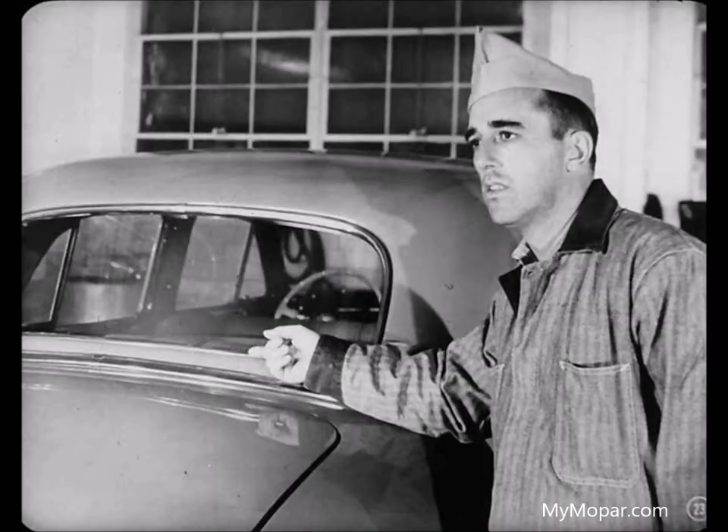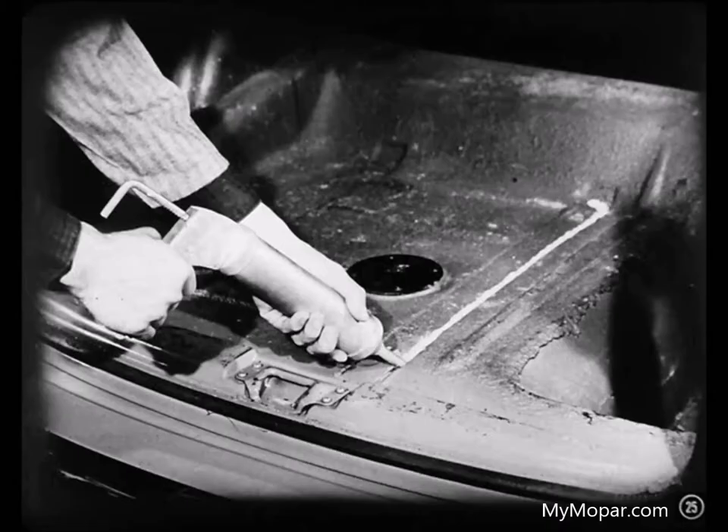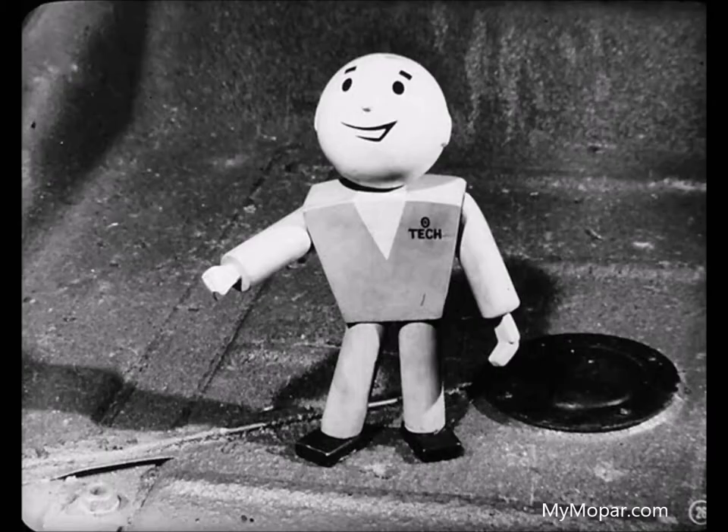I didn't see any leaks at the deck lid, so then I asked for water on the rear belt molding at the back just to check it. I get it, Joe. But how about the floor pan, like those joints around the gas tank supports, the wheelhouse brace, and the seams where the quarter panels join the floor pan? You can seal them with any good commercial caulking compound, Tony. If any floor pan seams are open, they'll probably let in dust more than water. Some mechanics use a flashlight or extension light to locate openings where dust could get in. Sounds like a good idea, Tech.